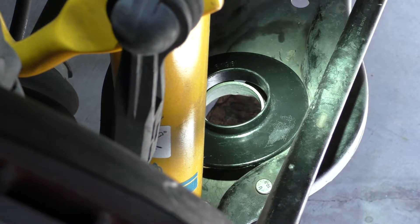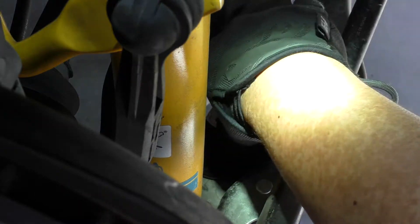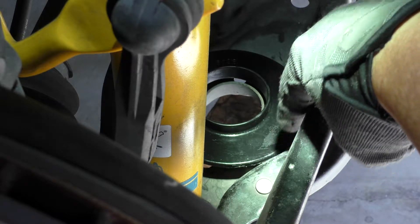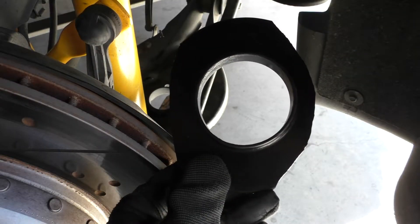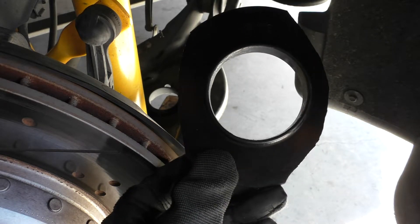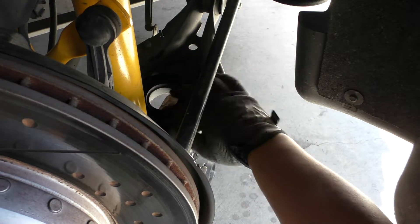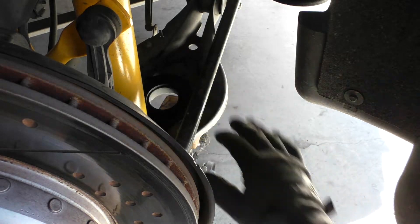As you can see, the lower spring pad doesn't sit quite flush all the way down — I can still push down a little bit. So I need to trim a little bit off the right edge. After cutting a little off both sides, I place it in and now it sits nice at the bottom.